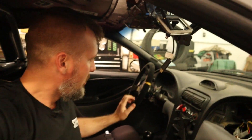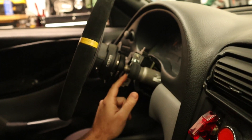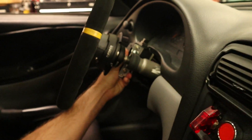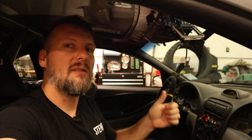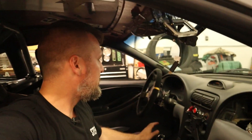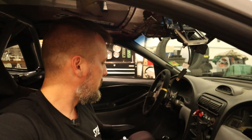The other thing I needed to do for the column — that I wasn't able to do in the original steering video — was wire up the turn signals, hazard lights, and all that. It's just a plate from Lowe's used for holding up a conduit. I put a little heat shrink on it to help it grip, and it doesn't actually rotate, which is quite nice. It all works as it should. Without it connected, the taillights on the car don't work — the taillights go through the hazard lights in order to actually work. We now have the factory Mustang turn signal switch with wipers, turn signal, high beams, and hazards all working.